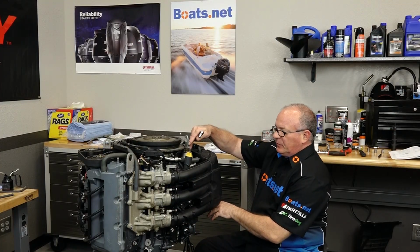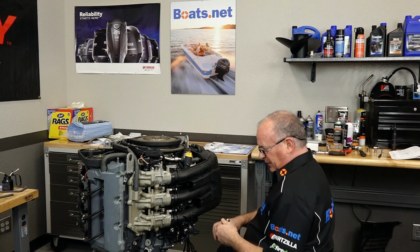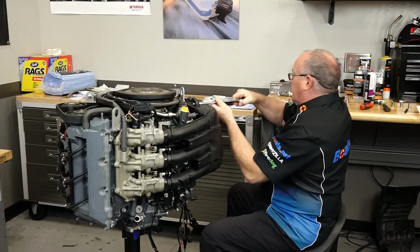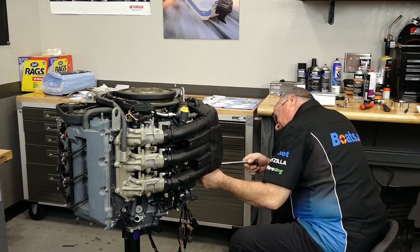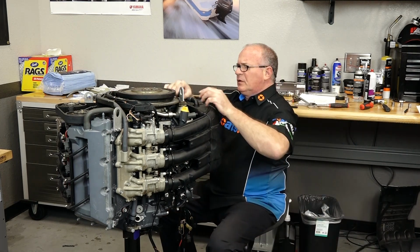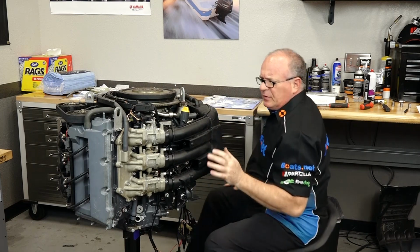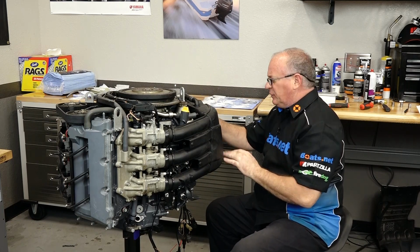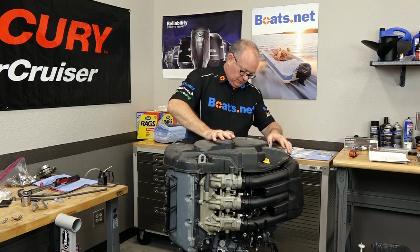So basically you only have 4 bolts or nuts holding it in place. 2 nuts up here and then a couple of bolts here and here. And once you get 1 or 2 of those started, it'll start to shimmy its way in. One up top, and one down low. Get this little crossover pipe in place. So we had 2 nuts up here, then 2 bolts here and here for this side, and we just had the same thing to do on the other. All right, now let's get our cover on and we will almost be through with this part anyway.